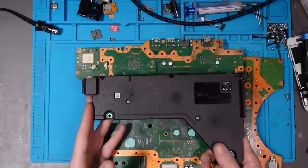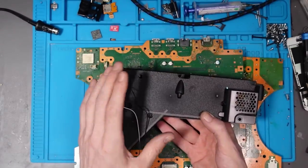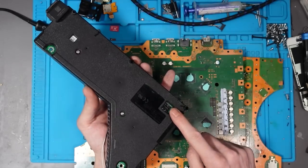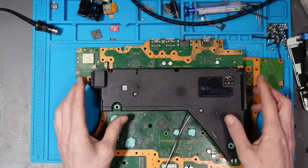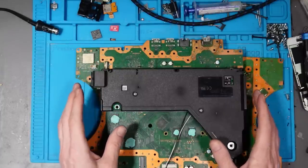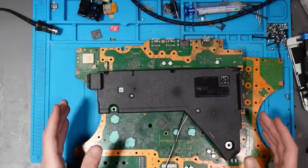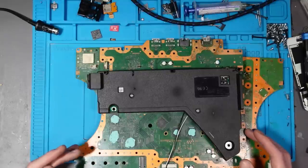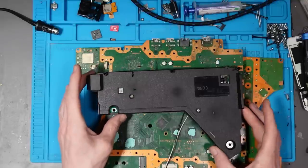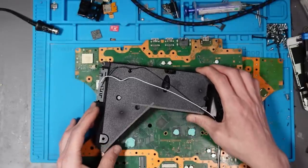The third most popular issue on the PlayStation 5 is the power supply itself. The power supply is responsible for handling all the power distribution onto the board — AC voltage comes in and we get 12 volts DC out. The common issue I've found is the PWM IC, which seems to fail spectacularly — it gets incredibly hot and the power supply just won't output 12 volts. I don't know enough about power supplies to give much advice on repairing it, so all I can say is to try and replace it, as power supplies are very dangerous to work on.